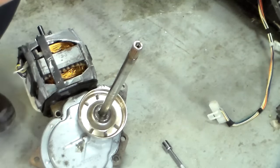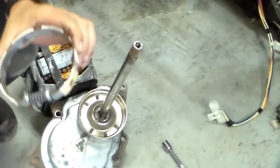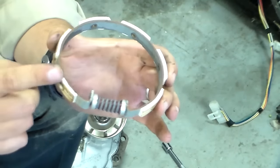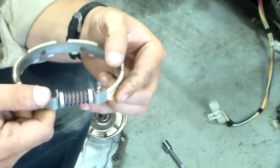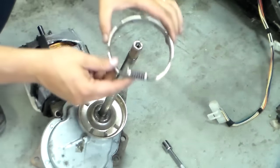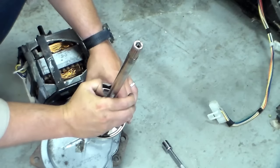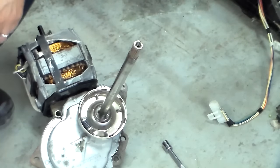So when you get the new one, you are just going to put your caps on, put the spring in, squeeze it together. You will get the new one — it will just be in pieces. You will have a spring and two caps. You will get instructions on how to put the spring together. It is just a matter of putting the caps on, putting the spring in between, and putting it together. Then take your new one, slide it down over, make sure your flat sides are up. Grab the spring with your pliers, squeeze, and drop it down in. Now you have just replaced the clutch on your washer.